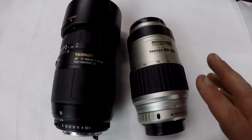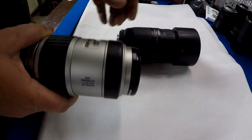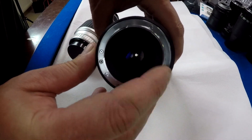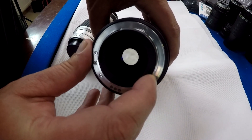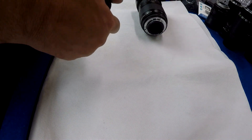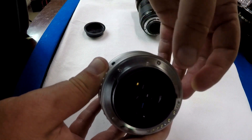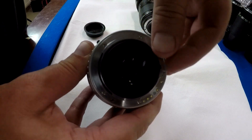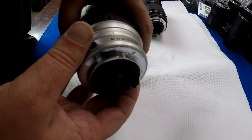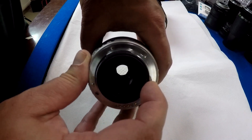The seller looked through it and said it's clear on the inside, but let me show you this. So this is how your aperture should work — the lever should look like that and you notice the aperture blade is opening and closing. But this is what this lens does: you hear that, it just clicks back and forth. Even though the aperture moves in there, it sticks on the lever, so it does not operate correctly on the camera.